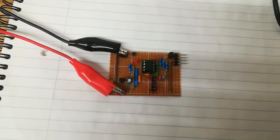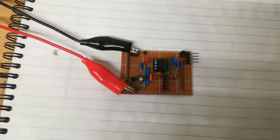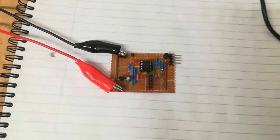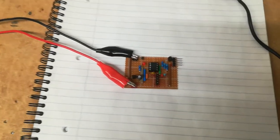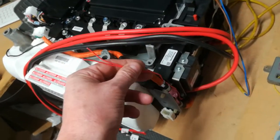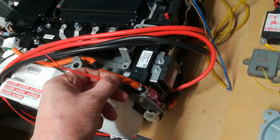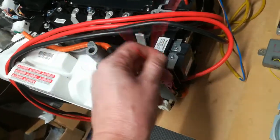Initially I'll be testing at standard voltage, which will just be the two LTO packs, and then I'll add another pack if that's successful. I'll then be using this device to help the system accept the higher voltage, and that works in conjunction with the BCM spoofer - the resistor matrix mounted inside here - which uses those two wires there that I just need to connect together for the standard pack, or add a resistor into them if I decide to up the voltage.